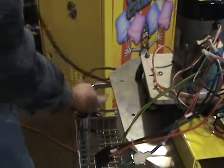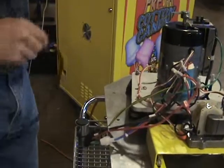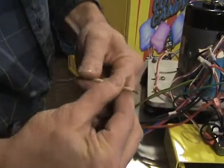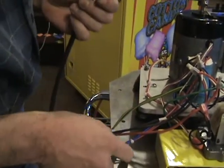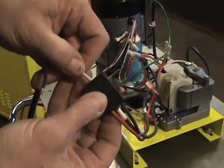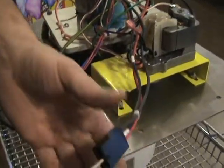Now what I'm going to do, I've got here a piece of wire, which is basically just a plug that I've stripped down to two bare wires. You want to make sure that you hook these up correctly if possible. The white is neutral or the same as ground. The black is your hot or your load wire. The center connector is your neutral, marked by the piece of white tape. So you take your white wire and put it in here. Take your black wire and put it in the spot for the red. Be careful because those will fall out relatively easy.